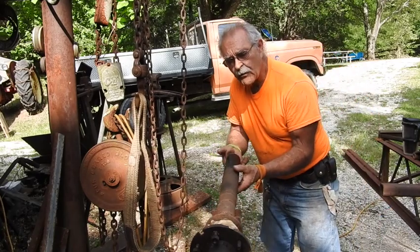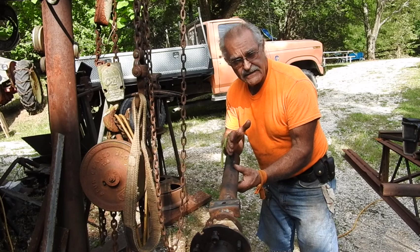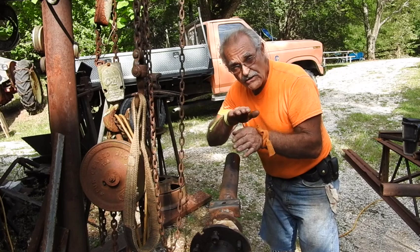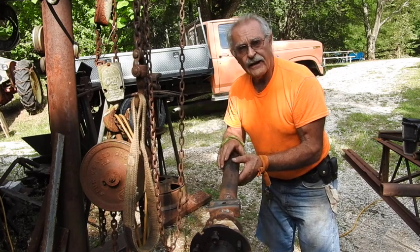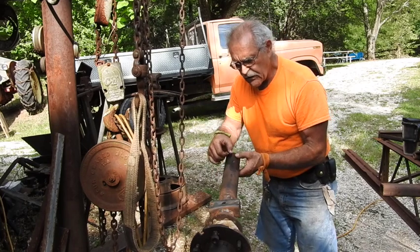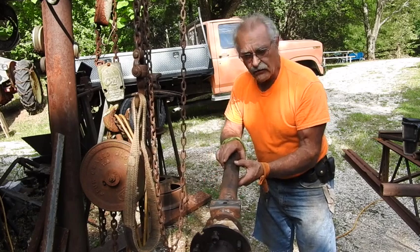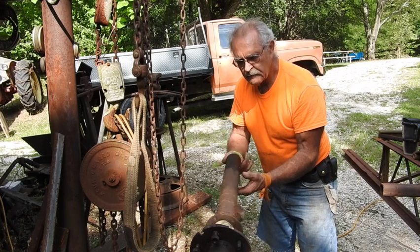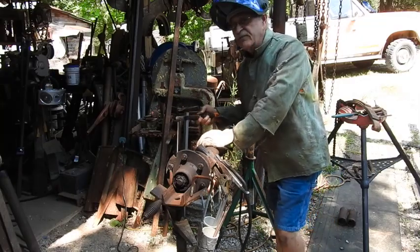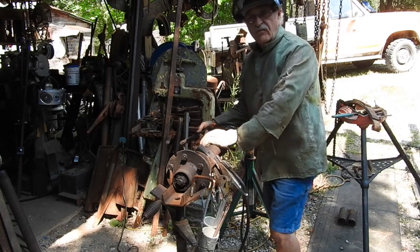When this thing is rotating around, you can actually see it going elliptical. Here's my little crack mark right here — that's the very top of this axle, which is the center line of the spring mount. That's because I still have a little bit of that bow left in this axle even though we cut so much out of it to shorten it down. So by having this perfectly straight up, we're going to maintain that little bit of a crown in the center of that axle. See how it wants to go around elliptical? It's not bent — that's that natural crown.